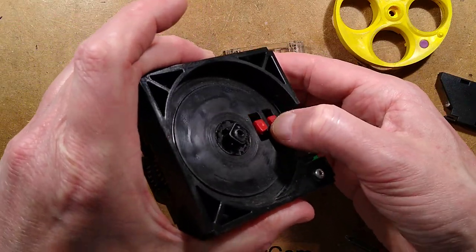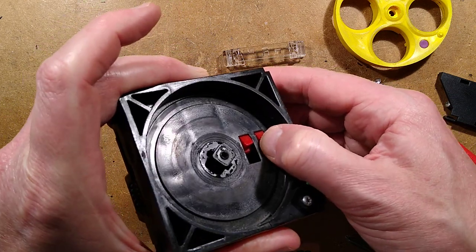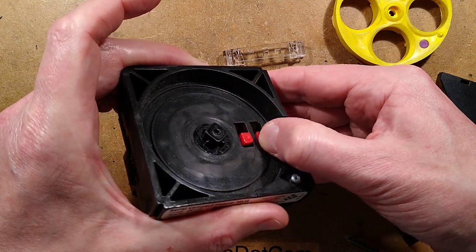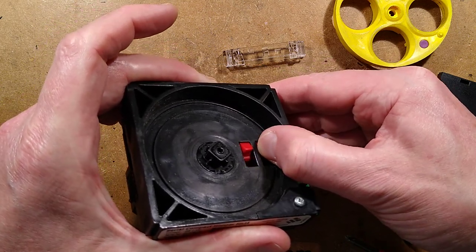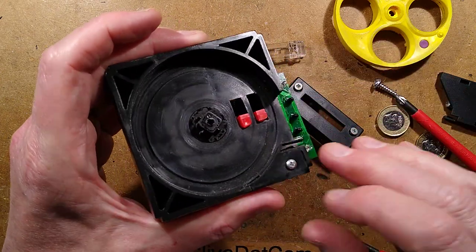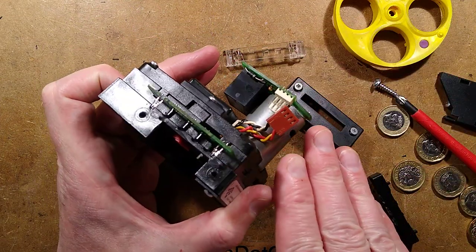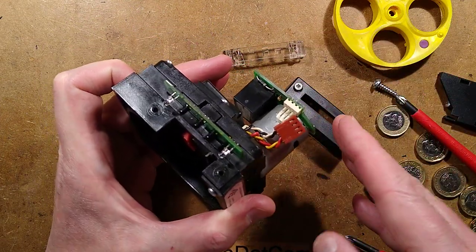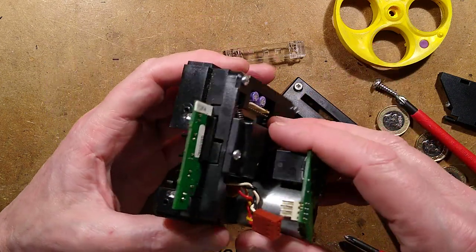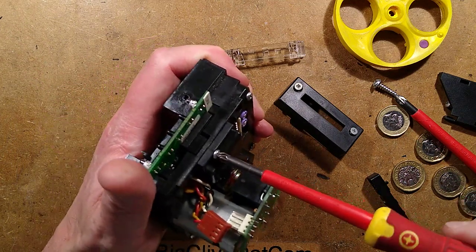Those little kick-back tabs basically hinge back like that - if the coin doesn't come out it would jam. I would expect the machine to be able to reverse the motor in the event of a jam - most of them do. So if it stalls you'll see it briefly reverse and try again, and if it fails after a certain amount of time I'd guess it would also send a signal back saying either no money has been paid out or that the motor has stalled, and send a fault code back.